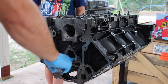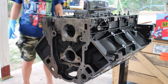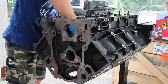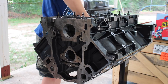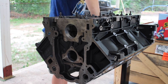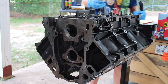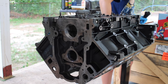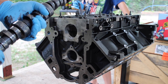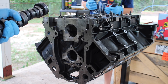You take it and rub it around here. Before you stick the camshaft in the engine, you have to make sure you pre-lube it. I had my son put some lube on the cam bearings also, so the cam can just go ahead and slip right through.